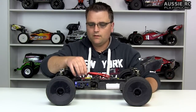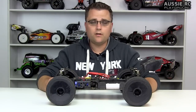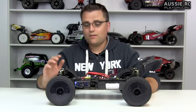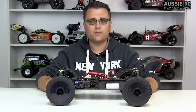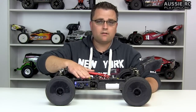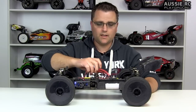So I came in, swapped a couple of the wires around, and sure enough, it then nearly monoed off the line going forward, but it was obviously a lot more controllable going in reverse. It was just the wires that were swapped around, and I think I'm not the only one that's had this issue. I did come across somebody else that I think had a very slow SaberTooth out of the box, and it's just a matter of swapping the wires around. If it happens to you, check your cabling, and you should be fine. You'll be able to sort that out very easily.